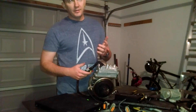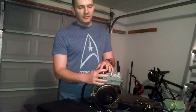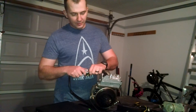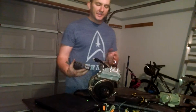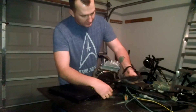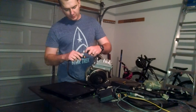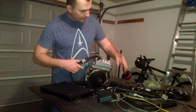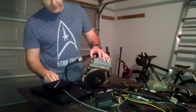Once you get this back on, you're going to want to cycle the power. So if you have a Cummins 24-valve, common rail, whatever you have, or even a 6.7, all you're going to do is turn the key off. In my case, I'm going to just disconnect it from here, which kills my power. Then you're going to reconnect your ECU, or your controller if you have one of my Banshee controllers. Then reconnect the turbo. And now it's indexed correctly.